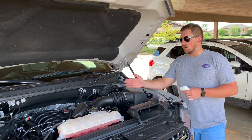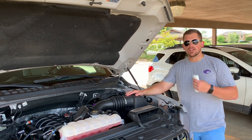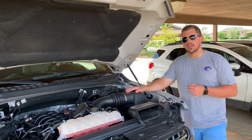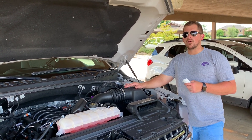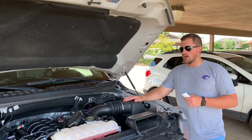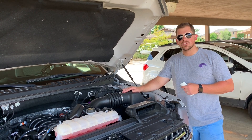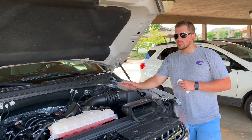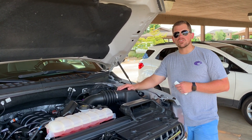As far as the oil I use, for a while I was using a Motorcraft synthetic blend 5W20 to get the engine broken in. That oil is a little light for Louisiana — we have pretty hot summers. In the summertime I went to a Rotella, their new gas and truck oil. It's still 5W20 but a little bit higher on the 20-weight scale, so it's a little bit thicker. I've noticed a little bit less valve train noise, and my gas mileage may have gone up a percentage or two, but I mainly did it just for engine longevity.